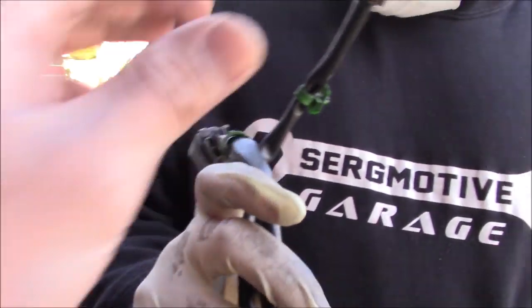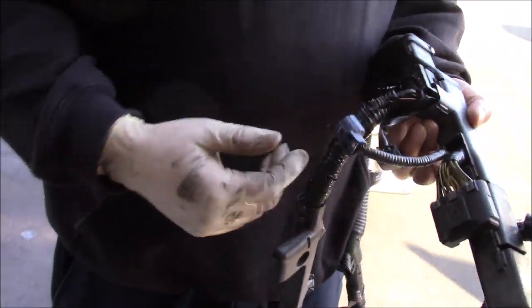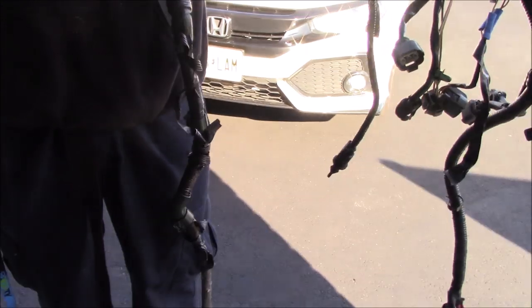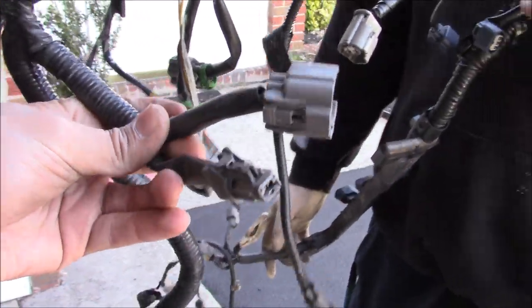The reverse lockout connector — they burned that up. That's a three-pin — that's your speed sensor. Everything else is there other than the charge harness, which is what I'm noticing. The charge harness hookup would be these connectors right here, which would hook up to a second harness that Carter doesn't have. Carter, are we keeping this or do you want to find a used harness? I mean we gotta work with what we got — I'm broke. So if you have a used K-series K20 harness, let me know in the comments or reach out on my Instagram and I'll refer you to Carter.